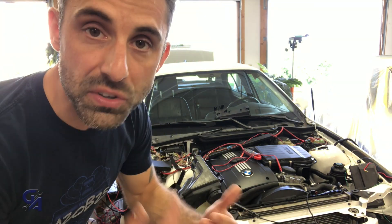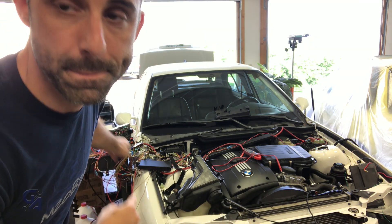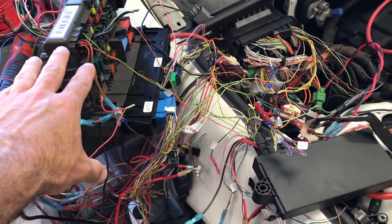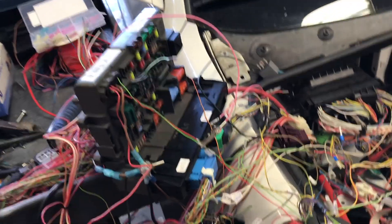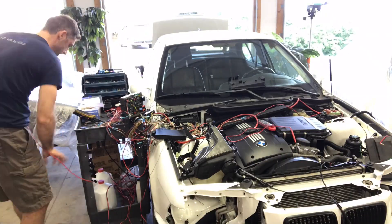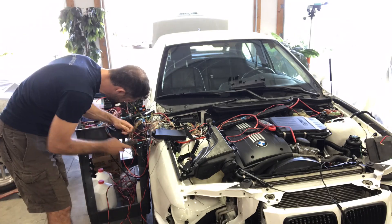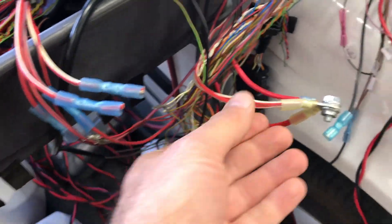Now that it's running, I'm going to start stripping the power away from the A4010 junction fuse box. The power and ground are supplied to both the CAST unit and the DME. It's been said this thing needs to supply switched power to the CAST and the DME, and I can see through the X6011 port that it's provided by the main relay right here. I'm going to supply that power manually to see if I can isolate this junction box.